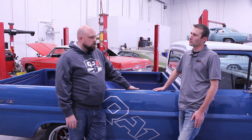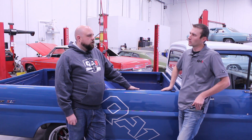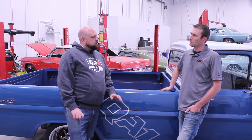We didn't want to make a whole bunch of different mounts. All three of those mounts use the same footprint — the same bolt pattern to mount to the car; they're just different in how they look. Since we were specking out the shock and spring ourselves, we didn't need to be handcuffed to those three different mounts any longer. We were able to use the same bracket for the whole run, and when we hit that 67 change, that meant a longer shock. So we technically have two different kits: one for 64 to 66, and one for 67 to 73. It was fun to decode what was going on and look at the cars through the succession of how they were built and designed.